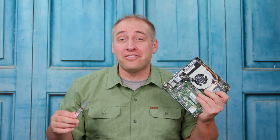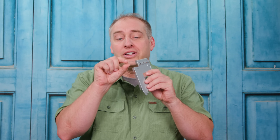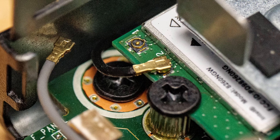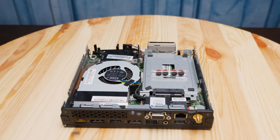There is also a Wi-Fi NIC on the bottom here. Something a bit nuanced is that part of the Wi-Fi antenna lead actually goes to the 2.5-inch hard drive tray. So when you pull out the hard drive tray — say for a RAM or SSD upgrade — you tend to pull the little connector out of the Wi-Fi card because it's so small and attached to the tray. Be very careful: if you do pull it out, make sure to reattach it when you reassemble. We've done a lot of these systems and have managed to pull this antenna off the Wi-Fi card just about every time we've opened one up.